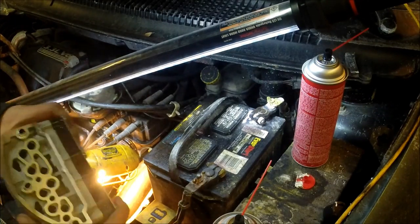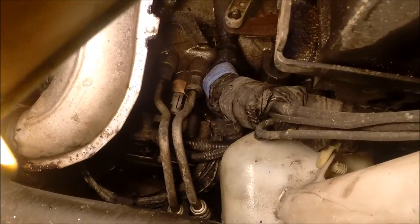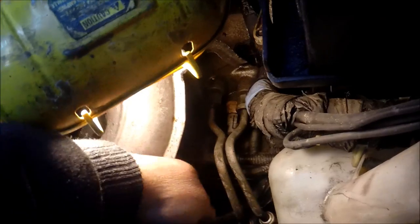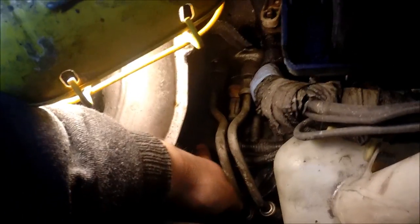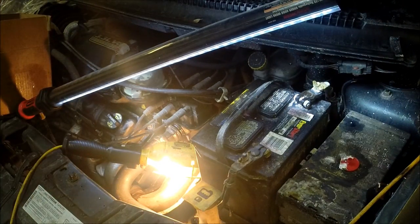What you need to do is replace this with its proper gasket. Its location is kind of down there right underneath the transmission lines. It's identified by the big connector right here and three bolts holding it on. Have brake cleaner and compressed air ready, and make sure you don't have any dirt and debris fall into the transmission.